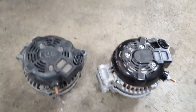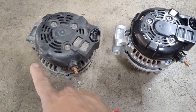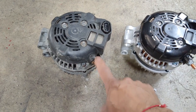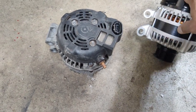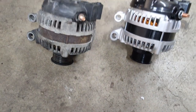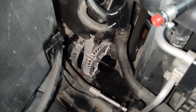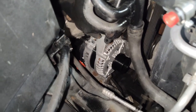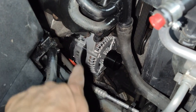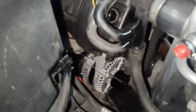We have a brand-new replacement alternator — not a remanufactured unit. Before putting it back in, make sure all mounting points are correct, cable connections are correct, and the plug positions match. Verify the pulley is the same as the one you took off. Installation goes in the same way it came out. Once the alternator is roughly in position, it's easier to make the electrical connections while it's still forward — there's one battery wire on the side and the plug in the back. The plug is hard to reach once it's fully bolted in, so plug it in before pushing it into position.